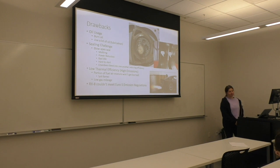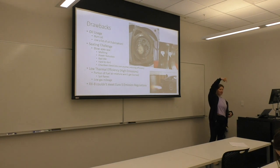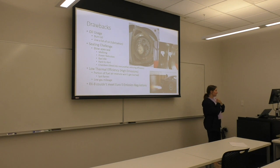Oil combustion is actually very problematic — you need a lot of air to combust oil properly, and with those small chambers you're going to get undesirable combustion products. That's why the engine isn't much in use. The oil is basically spraying and smearing around inside the engine — it's introduced at the top to lubricate the edges. Some of it can actually enter the combustion chambers, and once that happens you get bad emissions. To make the rotary engine more viable, it would need better fuel efficiency and a better lubrication system, because if you mess up the oil, the whole engine is essentially unrecoverable.